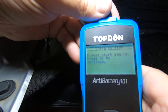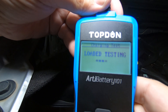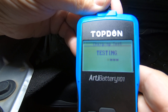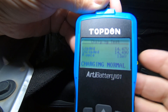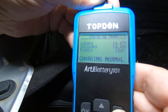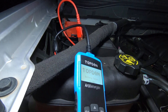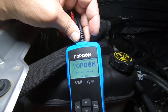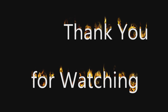The nice thing this does that I've never seen on other testers is the ripple test. At idle the ripple is about 13 millivolts. I think the ripple would actually get worse whenever you rev it up if it's a problematic alternator. This is a very nice little tester. I'll put a link to it if you're interested in a tester that does battery, alternator, and starter tests. This just might be the ticket. You guys hang in there — take care.